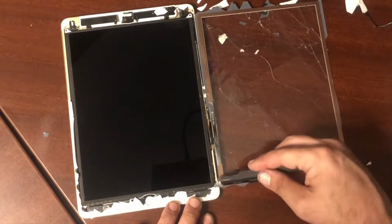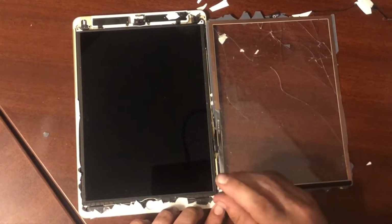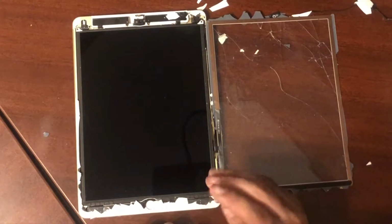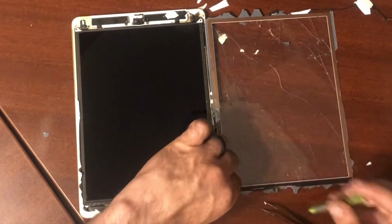These are anti-static tweezers that I'm using, and I'll leave a link in the description. You can use something wood or plastic. Just stay away from metal. Please, no metal tweezers. It can do a lot of damage.